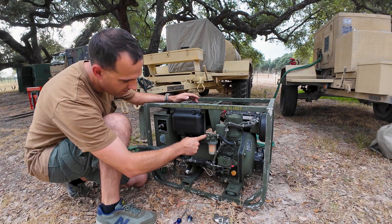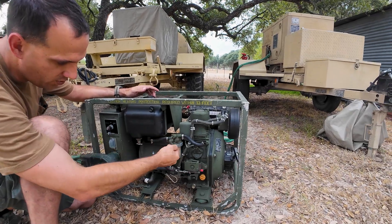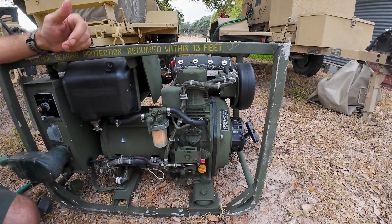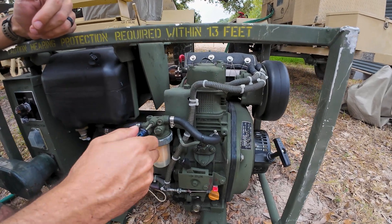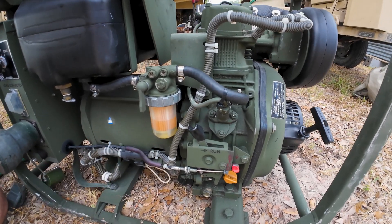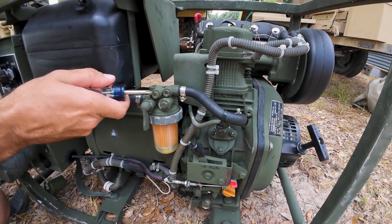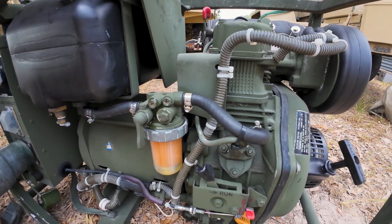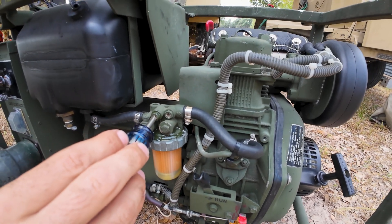Fuel's in here and it's running through to here. A lot of times on here, this facing down is open. This is what throws everybody off — you think it's open, why isn't it running? You have to open this first screw; that's a bleeder. You can see the fuel just started to flow in there. Leave that open, let the fuel flow in. Then you're going to see air and fuel start to come out of this screw. Let it bleed — it's going to make a mess, just let it bleed out. You might need to open it up even some more. I usually let it go until it starts dripping.